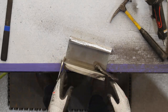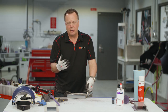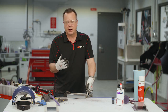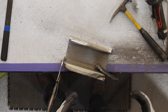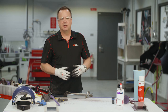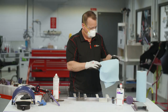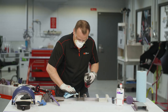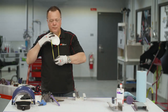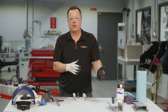We're looking for a nice flat surface with a nice abrasive grinder mark that's going to allow that adhesive to bond better. What we're looking for is grinding to what we call bright steel. If you grind and see a dull gray color, that indicates there's still some galvanizing remaining on the panel. You don't want that galvanizing under the bond — that would be the weak link. We've got this ground nicely to bright steel, ready to prepare for our adhesive. The next step is to clean everything up and get ready to apply the adhesive. Now we have to prepare the replacement panel — the host panel has already been completed and is ready for adhesive.